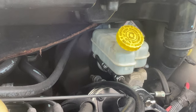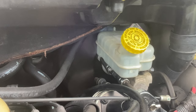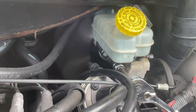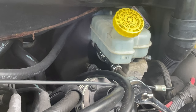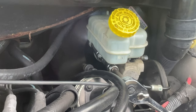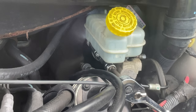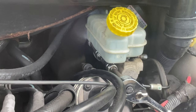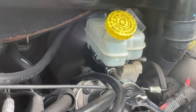You need to make sure that all four brakes on your Dodge Caravan — and the other models mentioned — do not have drum brakes in the back. It has to be four-disc brakes: front brakes with calipers and rotors, and rear brakes with calipers and rotors. If the rear brakes have no caliper and you only see a metal plate, you most likely have drum brakes in the back.